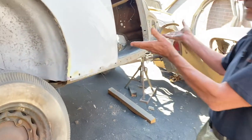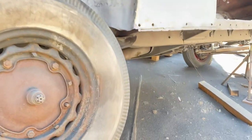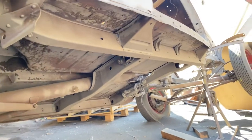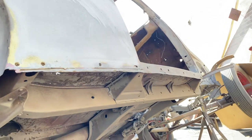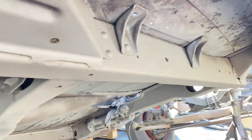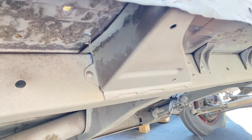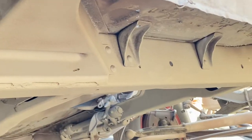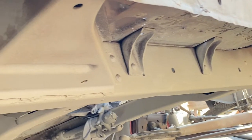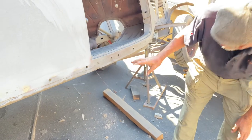So you've got that accomplished and now you have access to the bottom of the car. You're not laying on your back, you're not eating sand, which is not very flavorful. We can stand back, get away from the substrate, and get up in here and get all these little recesses. You can see here that most of this has already been done — this side is done. Do you see how beautifully the frame comes out? It puts a tooth on the metal, allows the primer to bond to something that's clean and has a profile. This has not been primed or anything — it just got finished blasting. It's down to white metal, which means there's no undercoat, primer, paint, or rust remaining. That's the way we want the whole thing so that when we prime it, it's got something to hang on to and acts as permanent protection.